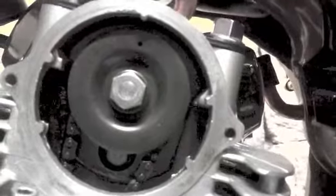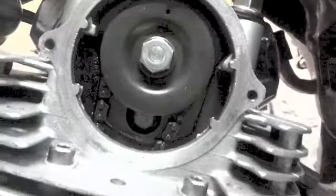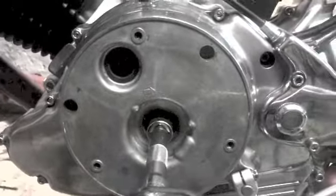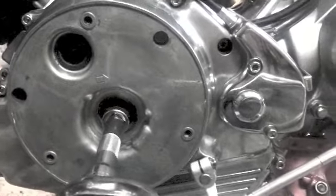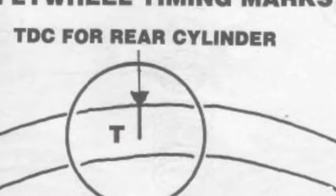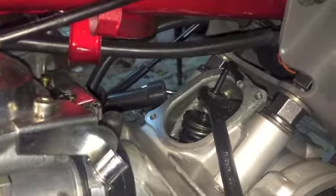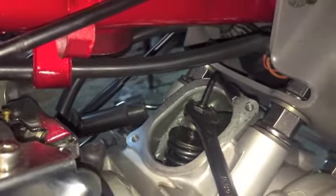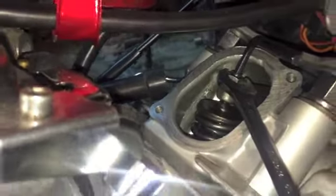Checking through, and although you can't see in that window, it's on top dead centre. So I'm going to turn it around so I get it lined up with the front cylinder on top dead centre and then I'm going to check the valve clearances. Just going to loosen off the back and adjust it because it should be 0.10 millimetres and it's far too much at the moment.